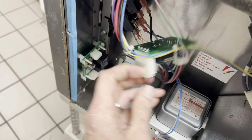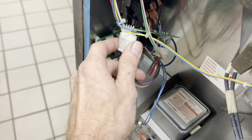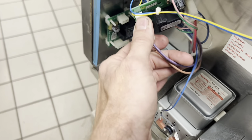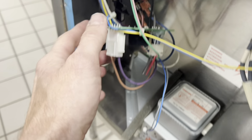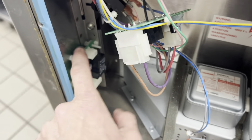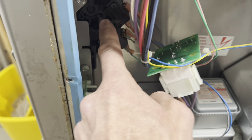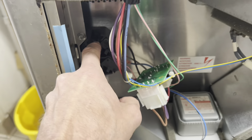With my popper in place when I powered it up, boom, it just went. Chasing the wiring diagram back from that, it runs into this relay board through the switches. I undid both of those and put them on a new board, plugged it in, turned on the breaker, opened the door and it seems to fire up. So this relay is the problem. The door switches are also getting to be a problem - they're worn down - but not the immediate issue.